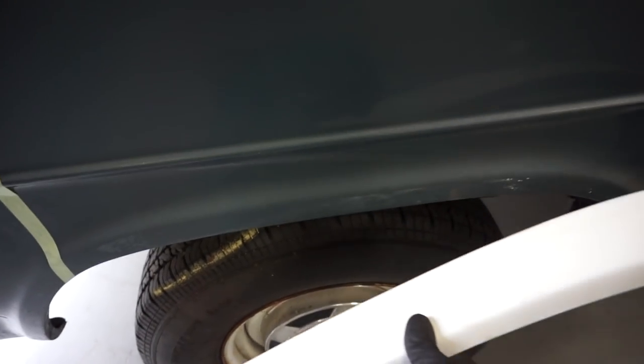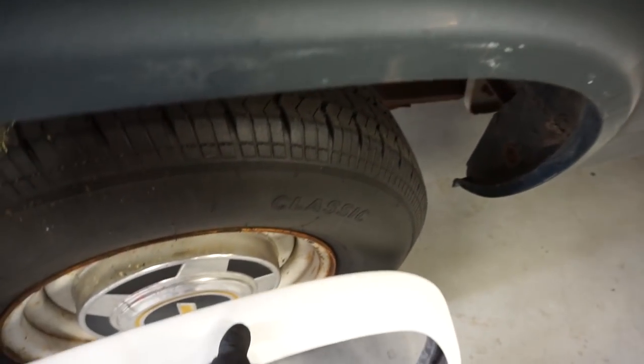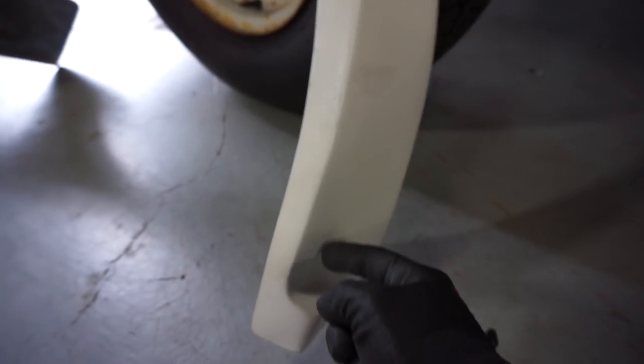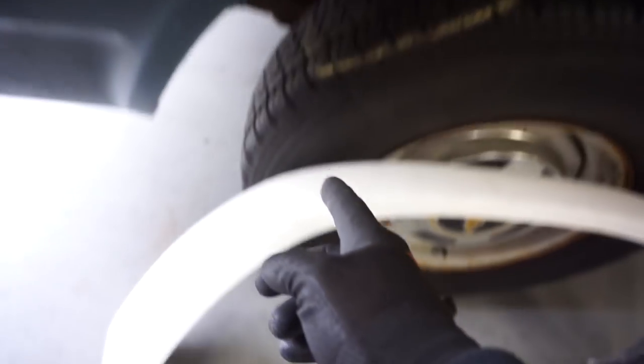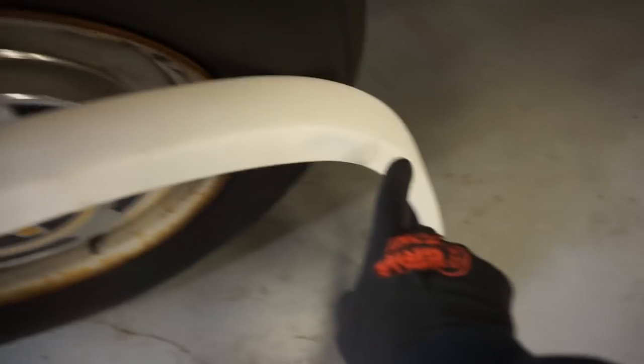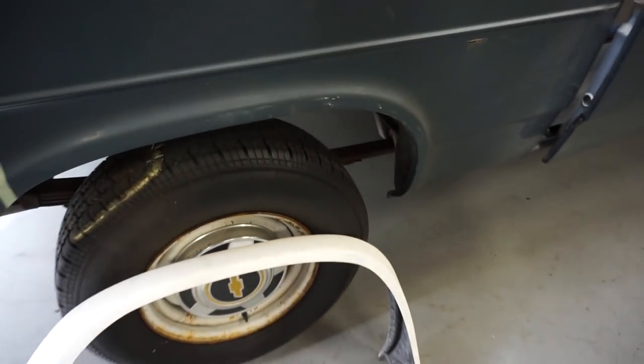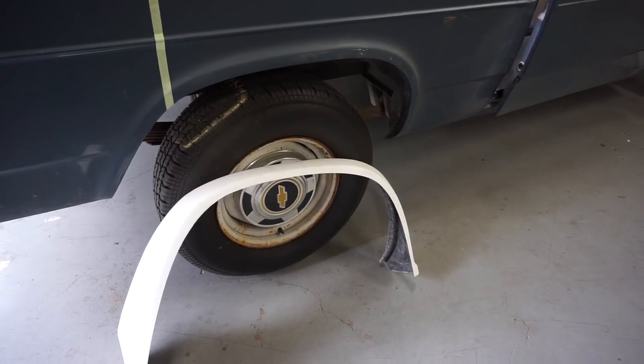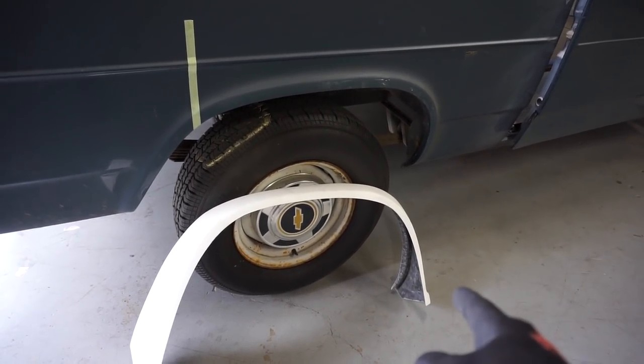This one fits pretty damn good. I don't think this body kit was made for the van that had a sliding door like that one. So when this thing slides it already hits here, all the way down to here, which is a huge problem — the door stops all the way here. This all clears, but when it comes to this portion and down, it hits — it's gonna smash, it's gonna hit really bad. So two options: we either don't run this, or we just modify this so the door can slide.